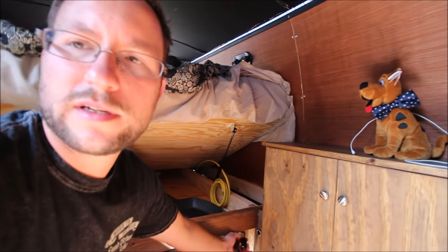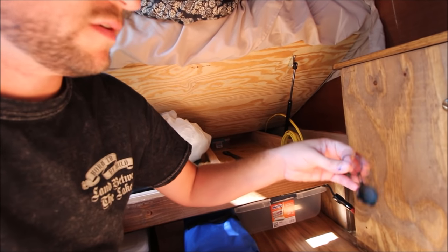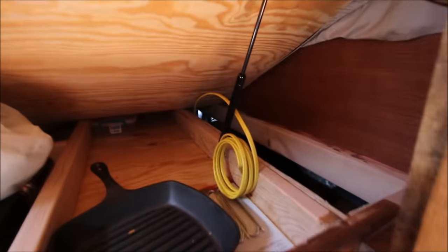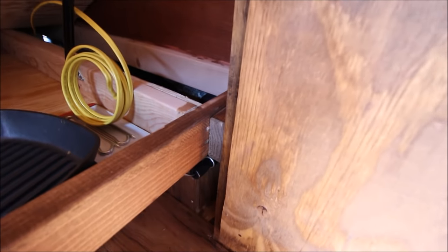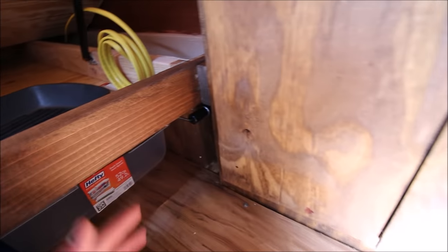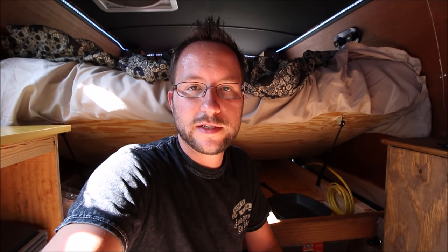It'll be a little difficult to screw the box in because of where it's at, but I think I can get it secured. I'll need to take this little rubber grommet off the 12-volt cover since it gets in the way. The wire runs to the back of the van and I'm going to tuck it all along in here and drill a hole so it comes down neatly. I want a plug here because it's centrally located, and the one in the back is specifically so I can plug in a window unit air conditioner at the back door without needing an extension cord.